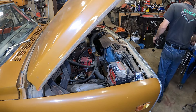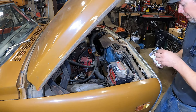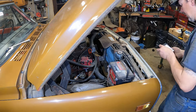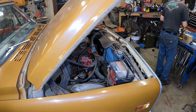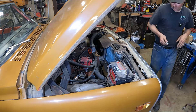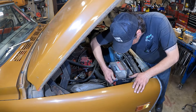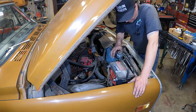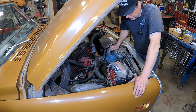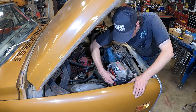I bought these converter deals from Die Hard at the auto parts store — they make it so you can put regular battery cables on a side terminal battery. They just thread right into the battery; they're lead, and that gives you a lug where you can put a regular battery terminal on. So eventually when this battery goes bad, I'm going to put a top post terminal battery on this. I'm going to convert my cables over now to top post, but I'll use these dongle adapters for now.